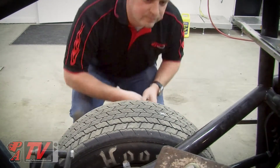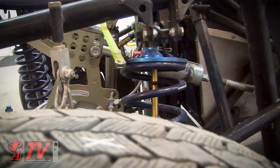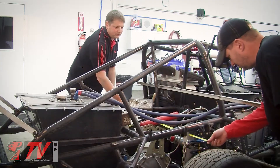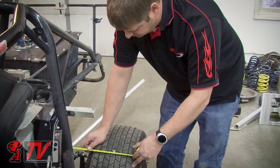We're going to rotate the tire all the way around and take measurements in four positions across from each other. I learned this method when attending one of our Bob Harris classes. It's simple and doesn't require more than a tape measure and a person you can trust to hold that tape measure.